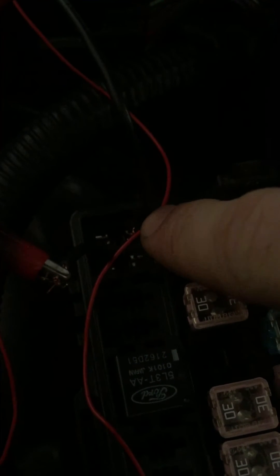Crank it a bunch of times, take the line off, make sure you've got a rag, then put the line in the milk jug. Pull relay number 41 — go ahead and pull that off. If you flip the relay over you'll see pins labeled 1, 2, 3, and 5. Match the pins up and you want to jump pin 3 and pin 5, which is the one adjacent to it.